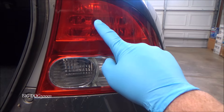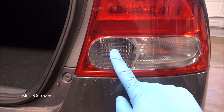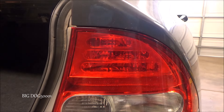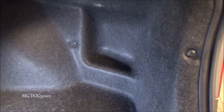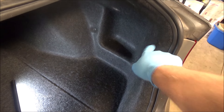Now let's check out this brake light. If we look here, there's a bulb right there — that's going to be our brake light and the marker light. This is going to be our reverse light, and this will be our turn signal light, so this is the one we've got to check. If we look back here, sometimes Hondas will have a little access panel right here, but this model does not. So we're going to have to pull this back in order to access our bulb.